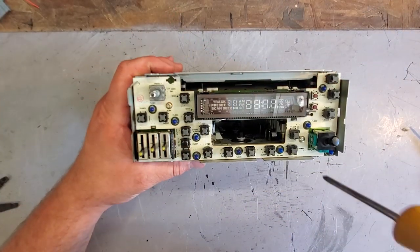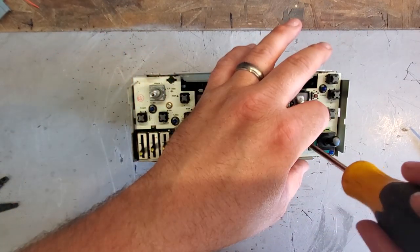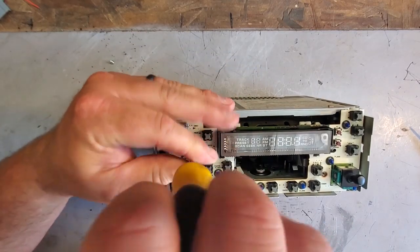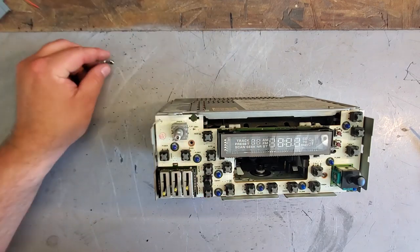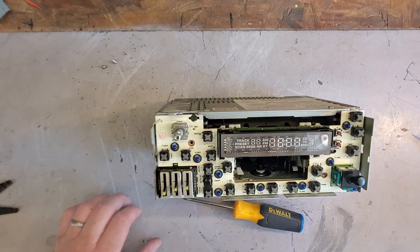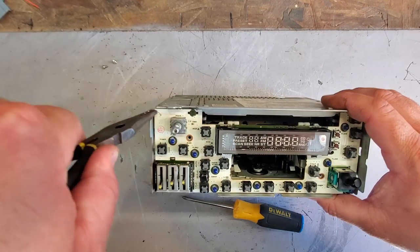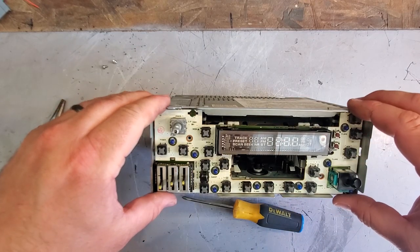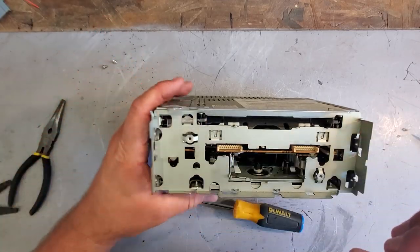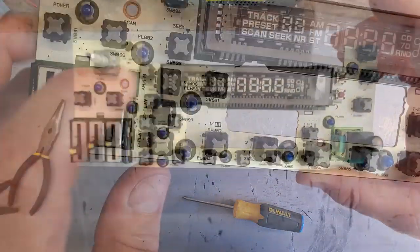All right, this is also very simple to take apart. There is just 2 screws in this main circuit board. 1 and 2. Is up here, and you're gonna need a small pliers so you can bend this locking tab over, and this should just slide out. There you go. I'll set this aside and we'll look at this.